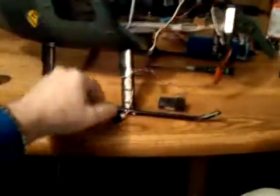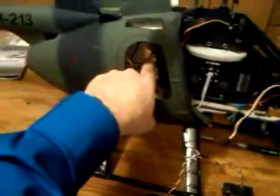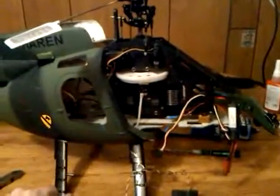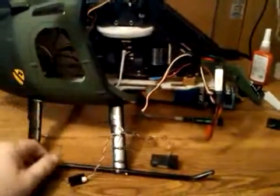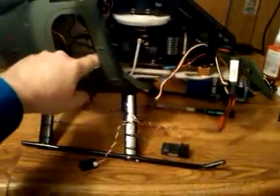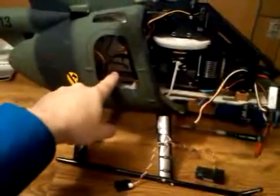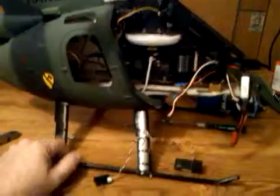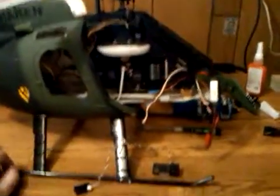But I got the radio out, which, to get that out, it was all the way in the back here. I had to be able to slide the 500 here forward to even be able to get to it, and to put in the 6200. Probably going to try to look at rerouting these cables so that I can mount the 6200 somewhere up here on the side that's accessible through the door for binding and other stuff, just make life easier. And then we'll still get the remote out on the bottom. We should have really good reception with that.